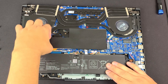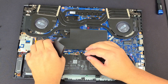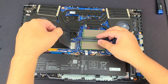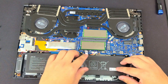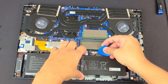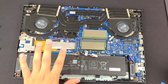So let's begin to see where everything is. This is going to be your battery here. Your SSD is actually going to be under this film, and also your RAM. I typically just slowly work this down — try not to rip it. The film's never going to be perfect like it was before since you're messing with it. Once you take that off, for safety reasons, we are going to unplug the battery. You're going to push this up with your pick, then using your nails, just pop it up. It's better not to work on something that has power.